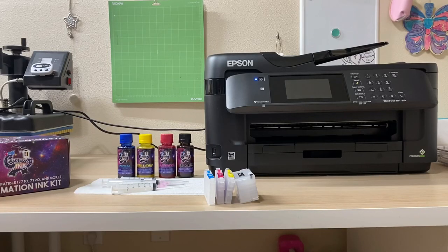The very first thing you should do is set up your Epson printer, make sure you've printed from the stock ink. You want to print from that stock ink because if something were to happen to your printer and you've only used sublimation ink, you're not going to know if it's the sublimation ink or the printer causing the issue. If you want to know how to set up your Epson 7710, I'll post my unboxing video in the description below.